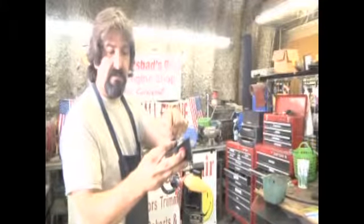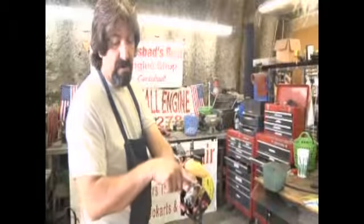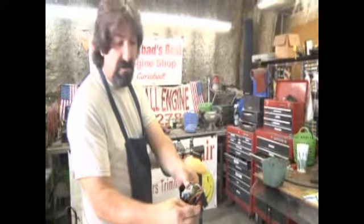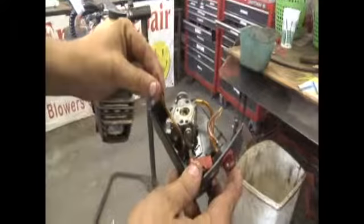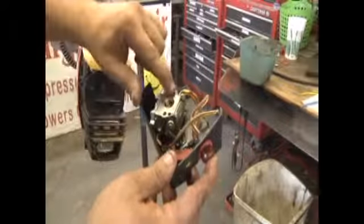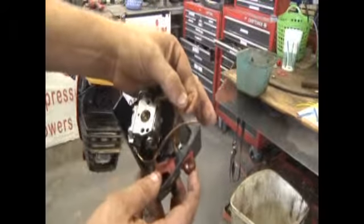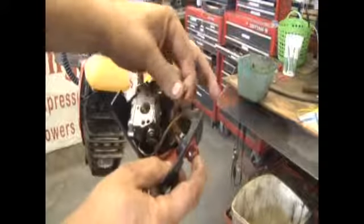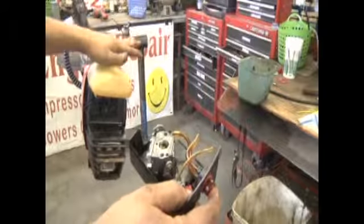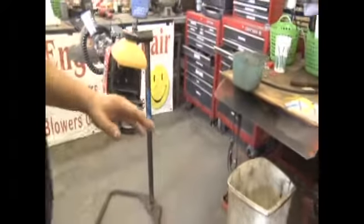Here's what's happening. The fuel is coming in through the small fuel line into your carburetor. It's going through the carburetor to these large lines. It is being sucked out of the carburetor, not pumped into the carburetor, back into your tank. So what's happening is it's coming from the small fuel lines providing fuel into the carburetor. The large fuel line is evacuating fuel from the carburetor that's not being used in the engine. And then this line, when you pump it, as you can see, is pumping fuel back into the tank. It's a closed cycle. These fuel lines and the fuel lines that go into the tank are the fuel lines that we're going to replace.